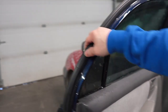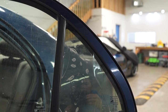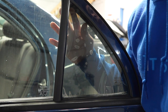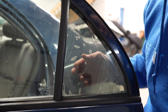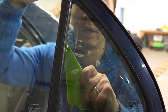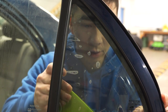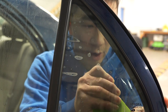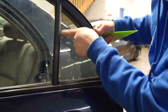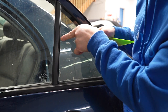Move to the outside so you can see. Check to make sure the film is in all the way up to the corner. Use the tool in the tight spots — that's where a lot of guys trim the gasket because it's a little tight. Let the film fall right in on both sides. Once it's all sealed, that's why it's important to have that extra eighth of an inch of film all the way around — so you can get the film behind the gasket.